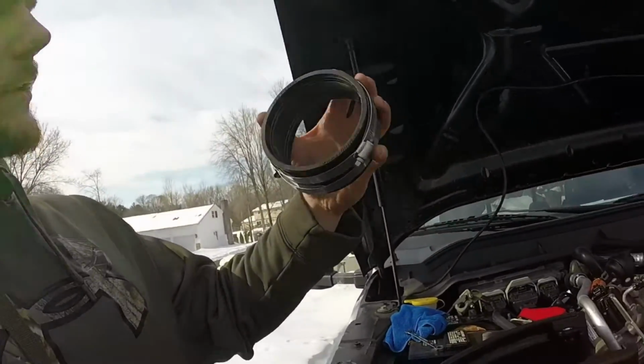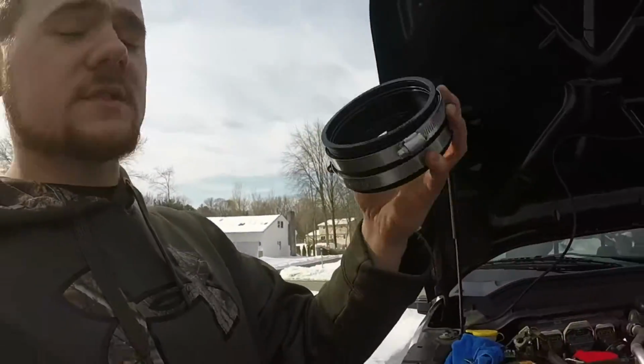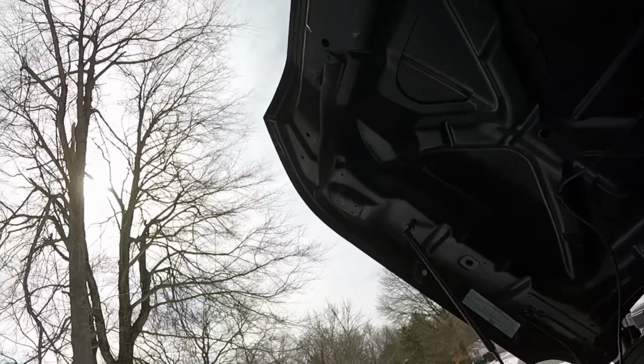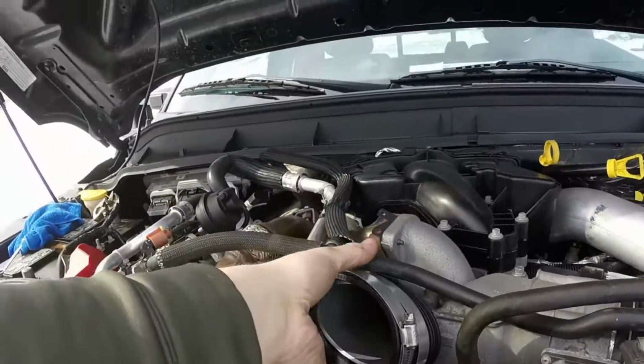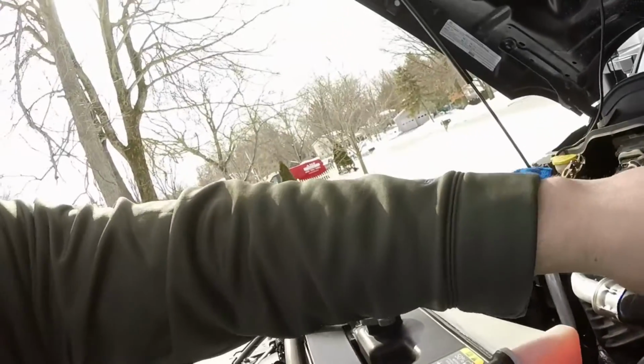Okay, so now you're going to get the smaller of the 2 adapter rubber grommets. Grab the 2 size 72 hose clamps, and again, these are going to be the same 5/16 if you want to use a ratchet or an impact. And you're going to want to tighten it down only on that intake inlet right there. Try the turbo inlet, and then that'll be it. And you just clamp down the side on the turbo inlet.